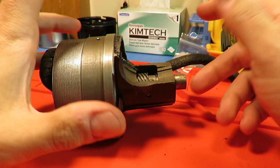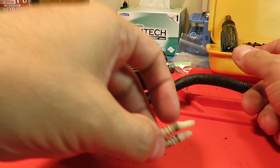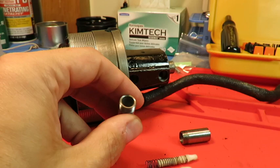Just some final considerations. You know, I said we were all done. We're not really, because there's, of course, these grease tubes to fix. And I have new felt wicking wound in the old springs here. And the cups themselves that I've shaken down with some grease inside there. Shake it down like a thermometer to get it into the base. And I'm just going to put those back together.